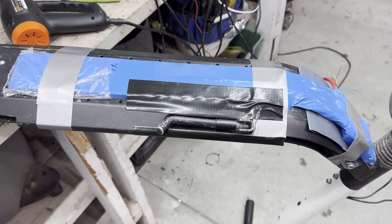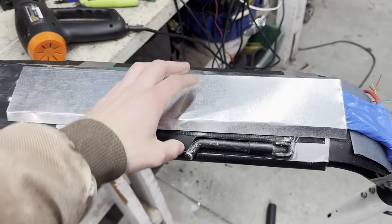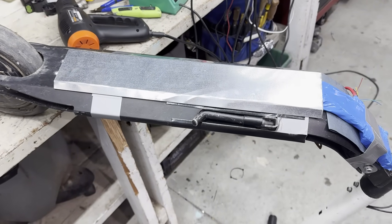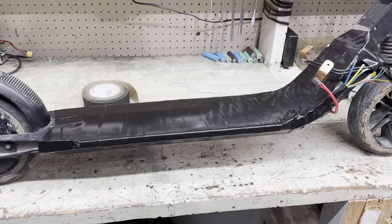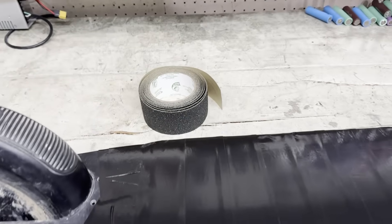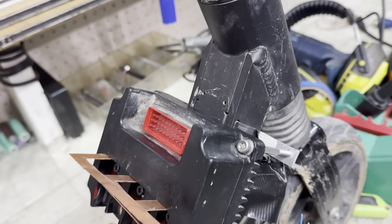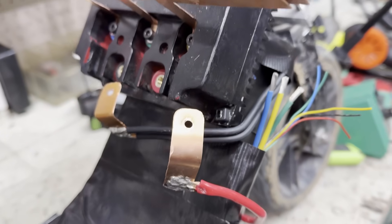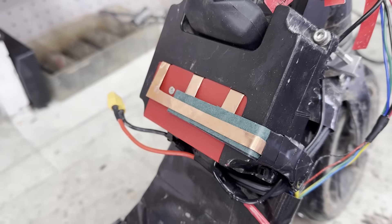I mounted the battery in the scooter and was going to start taping it up with black tape, but I realized I should first cover up the battery with some protection, so I got this little metal sheet. That should help a bit if anyone bottoms out the scooter or any rocks hit it. Now I'm going to use this black tape and start taping up the whole scooter. After wrapping it in tape, it looks pretty good. I got this rubber piece that's supposed to go on there, but I think I'm just going to put this grippy tape on. To mount the controller, I used an aluminum piece up there to bolt it through the top holes, and then just put a zip tie through the bottom holes. Since all the wires are so close, I used some copper to make them all fit. I got it all finished up and I think the exposed copper looks pretty cool, so I'm not going to cover it up.